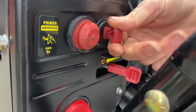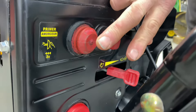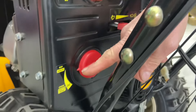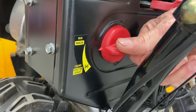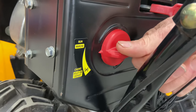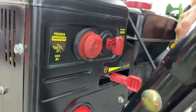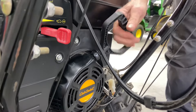So we're at half throttle, we have the key in. This is your primer — depending on how cold it is outside, I'd recommend definitely three primes. If you're 20 degrees out, you may want to do a couple more. Your choke is down here — it shows 'start' and 'run.' Choke on is all the way like that, choke off is like this. So we're going to have the choke on, prime it one, two, three times. This is your pull cord here — if everything is operating as it should, it should fire right up.